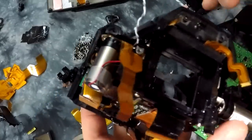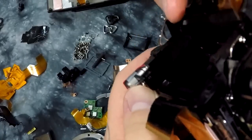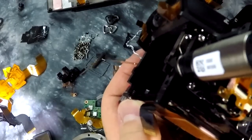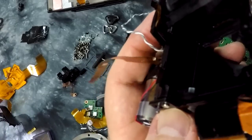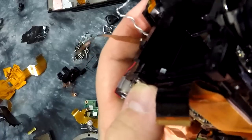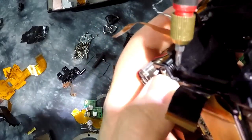This is looking top down on your D500. Here you can actually see a better view of the springs. You see right here? There's a three-point mount on the sensor assembly, and you can see one of the springs right here. You see underneath my thumb? You see the springs? This is to level the sensor. There are three points on the sensor to level it, to make it completely flat against the focal plane. We have three springs right here, just like shock absorbers in your car.